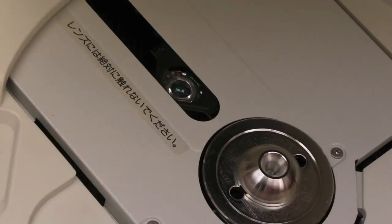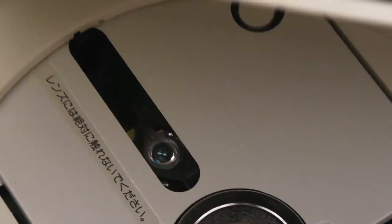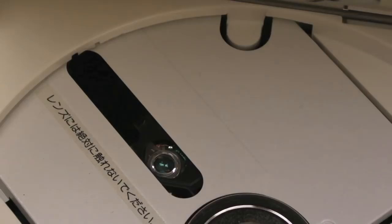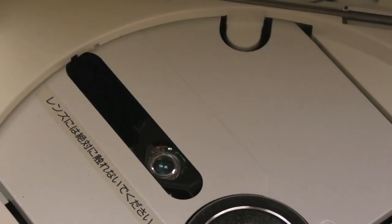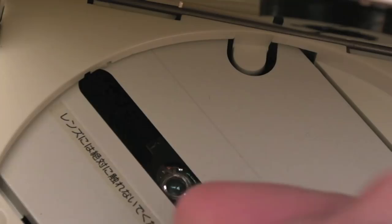Still doing the same. I've zoomed in and I'm tricking the switch down so it thinks the lid is closed, then click play — let's see if we can see any signs of activity. I thought I saw some laser activity a moment ago. I'm not sure — you have to be careful not to look at it straight on obviously. What might be happening is the laser's faltering — it could be the focus coils on there, that's a possibility.